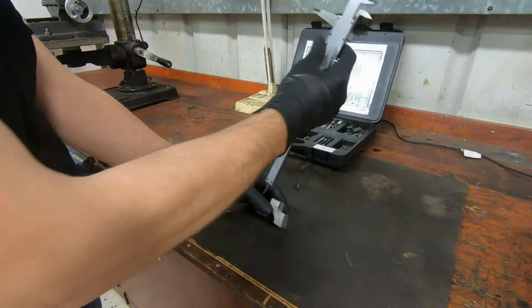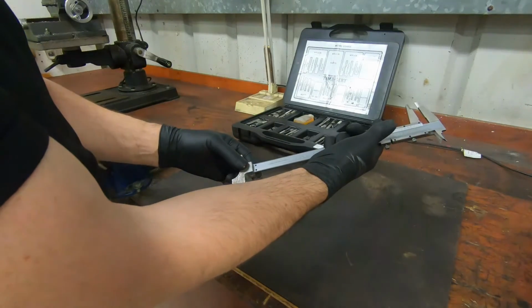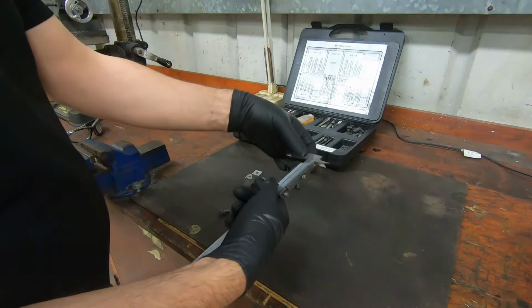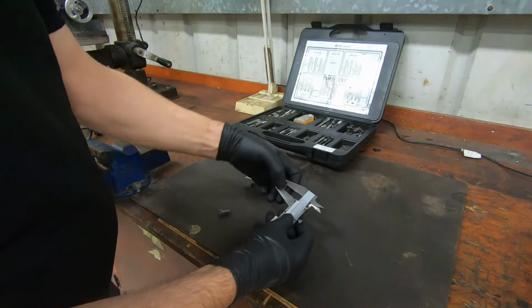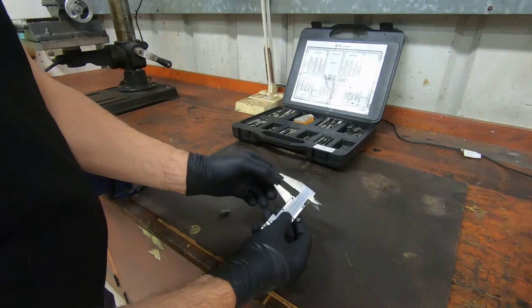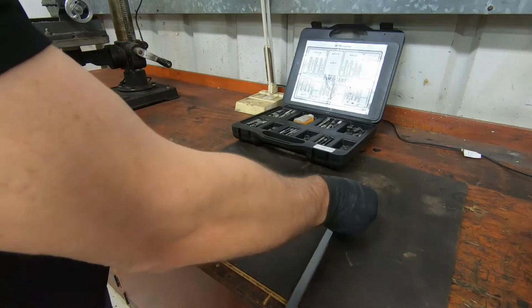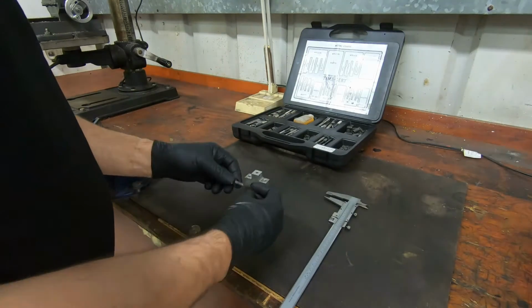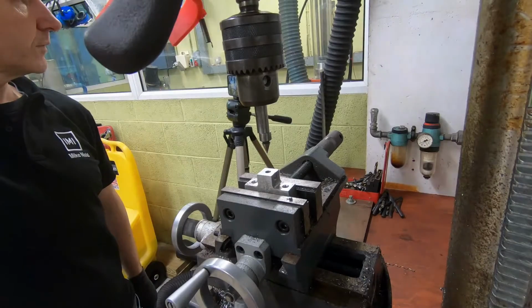As the bolt hole is blind, that means it doesn't go all the way through, we do need to select the correct length insert and know how deep we're going to drill. We also need to make sure the insert is the same thread as the original bolt.